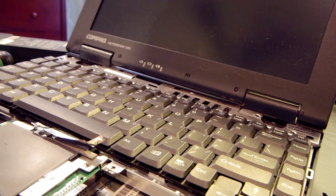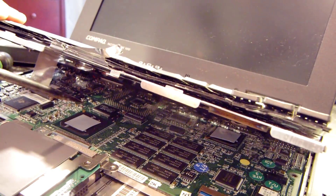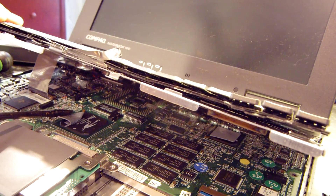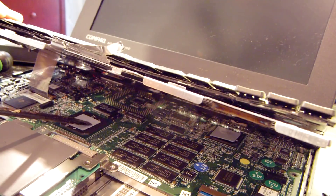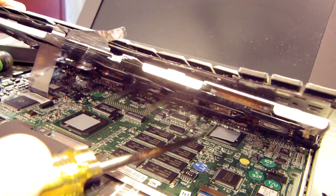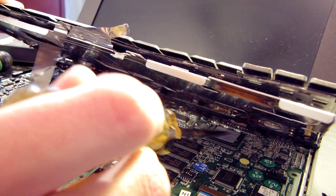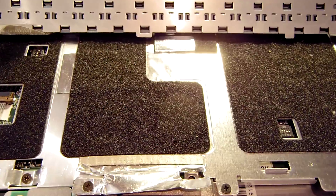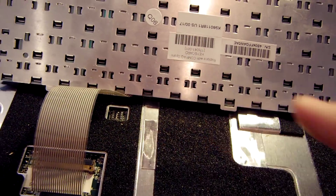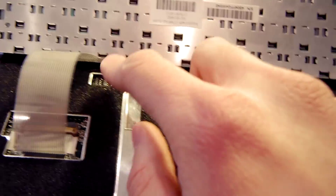I couldn't help myself — I wanted to see what those chips were, so I pulled the thermal pads off. This one here says Cyberblade i7 Trident — this is our GPU. I'll put that one back on. The one all the way in the back says VIA, so this is part of our chipset, most likely the north bridge. I also noticed they leave openings for these jumpers, so you don't even have to take all this off — just pop off the keyboard for easy access thanks to these metal cutouts.